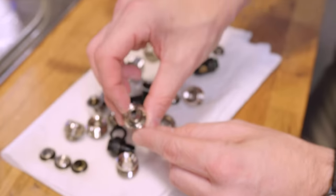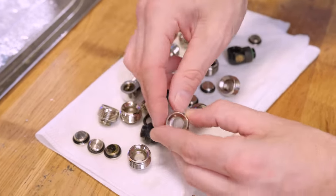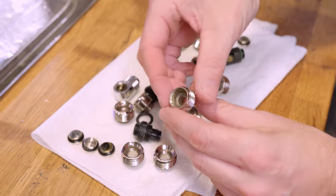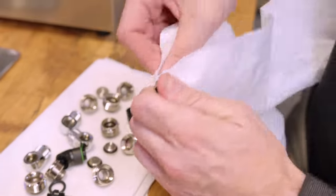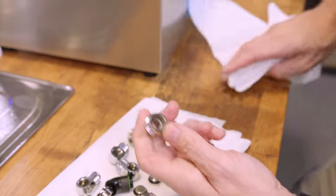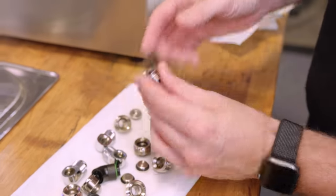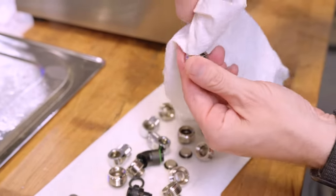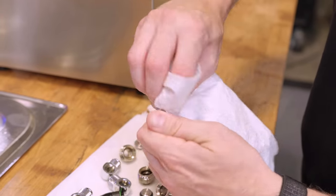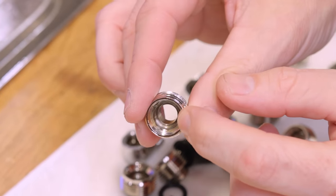Some of the fittings do have some minor nickel flaking that happens with the type of coolant that was used. I already explained that these were both abrasive-type coolants in the Threadripper and Skunk Works build, because the opaques do have some abrasiveness to them — they have like a grit to them. So this will also expose anything that has eaten through the nickel, and if any corrosion or oxidation has started to happen on the metal underside.